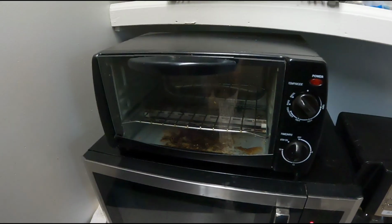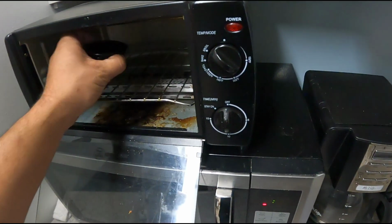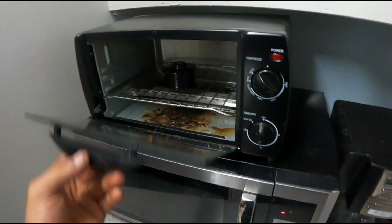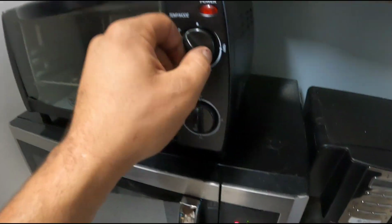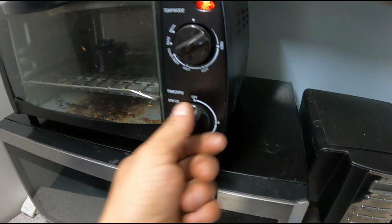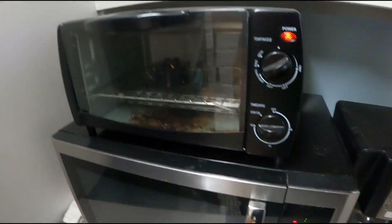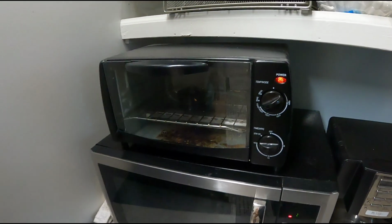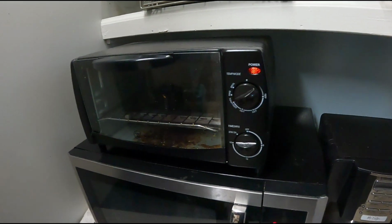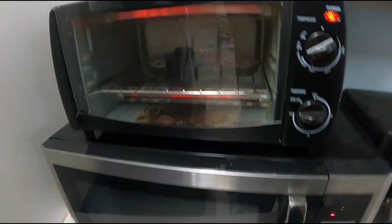So what you have to do is get this pulley hot. Best way to do it evenly is to put it in an oven. You can use a real oven or a toaster oven, it doesn't matter. What I found works is just to run it up to about 450 and just let it cook for, I don't know, maybe 25 minutes, half an hour. Let it get real hot, and then after that, time is of the essence.